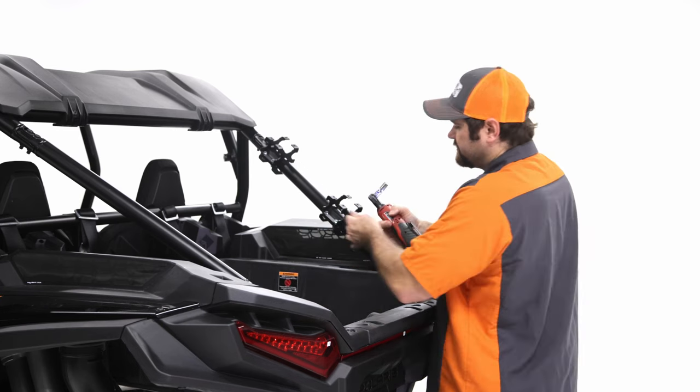Now that you have your bolts started, we're gonna go ahead and set the sides now. You will need a stool because you need to get up on top and look down, but there's two bolts that are right underneath here, right in front. And those we're gonna tighten first to set the angle of the sides. And you're gonna want to actually tighten them right in the center of the slot on the basket tray.